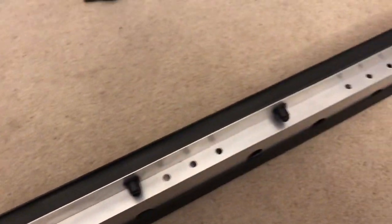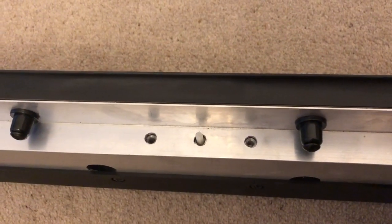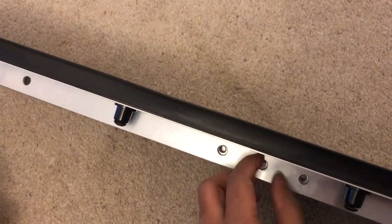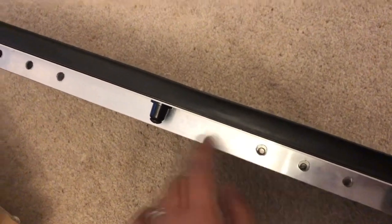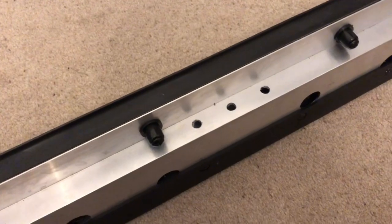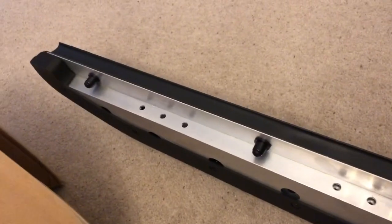holes all the way down. A lot of them will be just drilled holes, but you'll have two with a plastic kind of nut coming out of it, and two screw holes either side. What this allows you to do is remove the little plastic retaining nut and move the female screw holes to different positions depending on your model. On mine, they come out of the box generic, the same. I need to move them to the second from the front and to the last one.